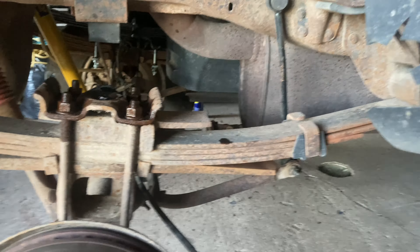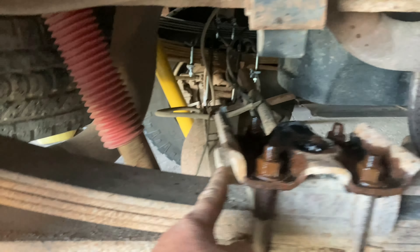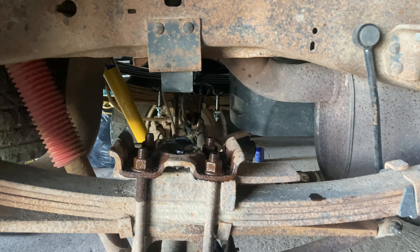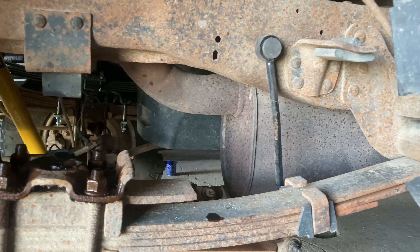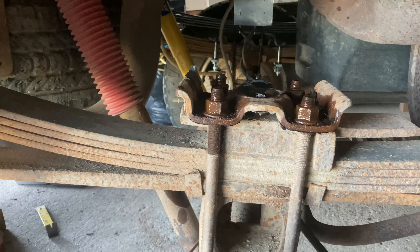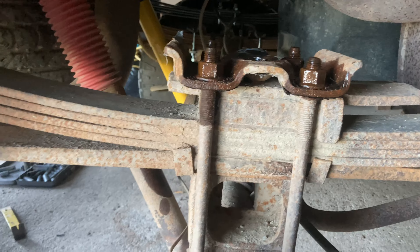There are lots of videos out there on how to do this - they do a pretty good job of showing you how easy it is and how quick they go on. The main thing I want to show you here is a problem I encountered that didn't have a solution. In addition to your one-ton springs there's also this apparatus, this blocking, and as you can see a broken spring - a factory forward overload spring or aftermarket one that didn't cut the mustard and broke right off.